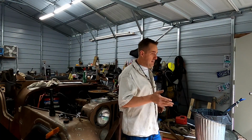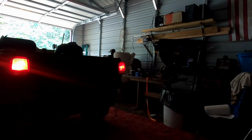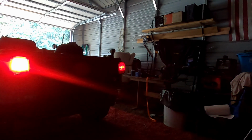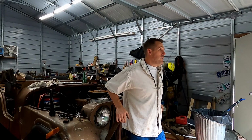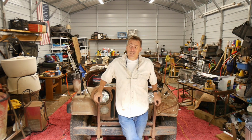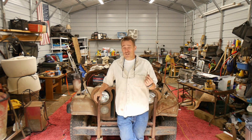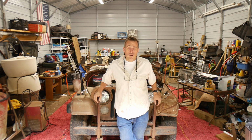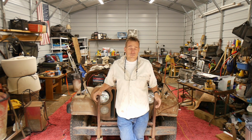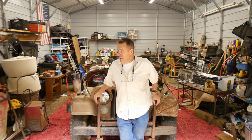The back, like I said, came together just this afternoon. I got a wild hair, I was going to knock off and went back there. I was like, oh, these don't look that hard. And turns out they weren't. So hopefully you've enjoyed some footage of my turn signals in the rear working. The brake light does not work, however, and that's due to, I believe, the brake light switch being stuck on. So I'll be getting one of those routed out here or mailed out here, whatever, and get that fixed.